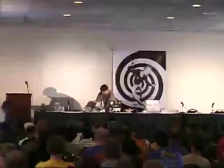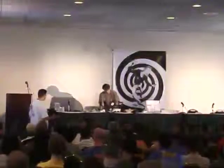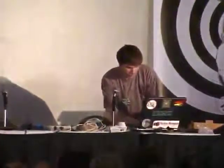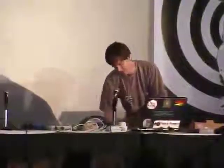I do have a link light on this WAN cable. I just don't have a, like, it's not actually getting me anywhere. Somebody suggested I set the router for DHCP and see if that gets anything. That's not a bad suggestion. Let's do that and then use yours. So, do you have dual NICs in there? Well, not the same type of NIC, one wireless, one wired.